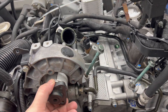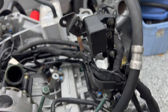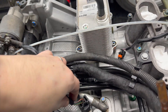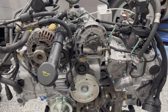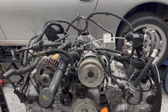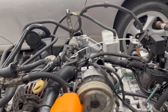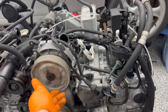I've got the power steering tubing all routed and good to go. Everything's clipped in. I've got a couple of other connectors that don't have a place just yet. It's getting close — I still need to put a pulley and an idler pulley in. Back at it: power steering pump is installed, pulleys installed, idler pulleys installed, alternator is installed. I fixed the power steering hang-up by pouring a little bit of power steering fluid in there and now it's running smooth — which is good because that part is expensive.